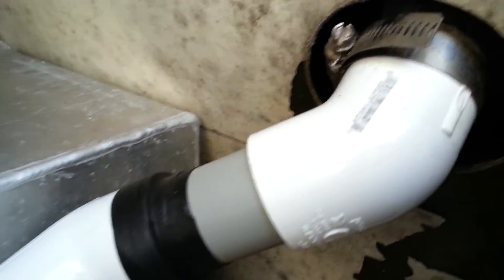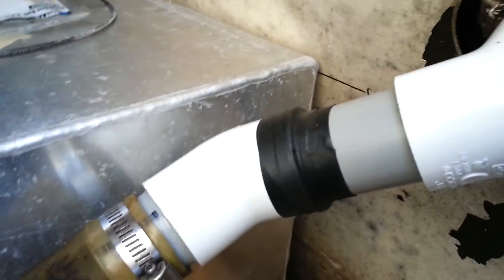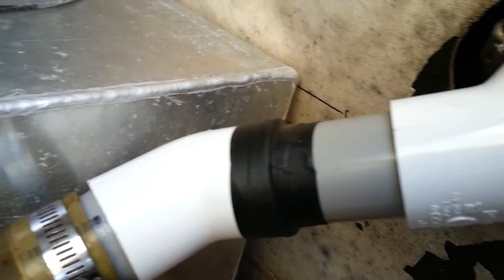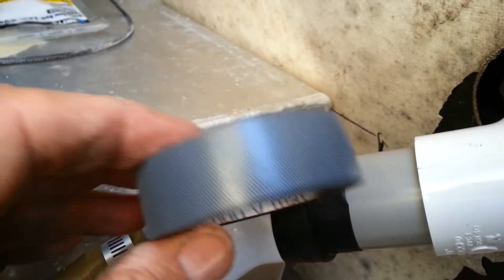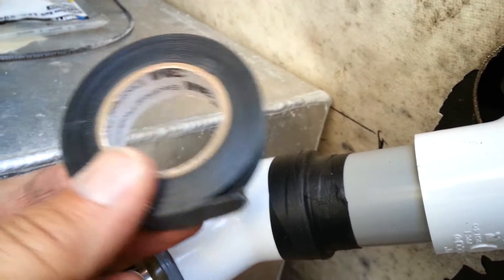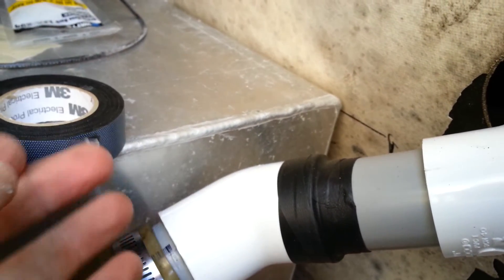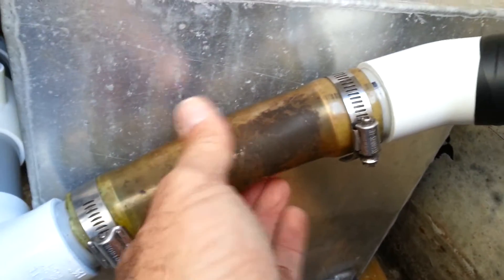This is the ground wire coming from the fuel fill cap, and this is the cockpit drain. What I've done is kind of hard-plumbed most of it with some soft points in it. This joint is not glued, and I use a fusion tape made by 3M — I absolutely love this stuff. You stretch it really tight and it sticks to itself, but it's not a sticky tape like electrical tape.